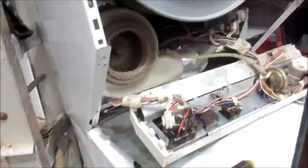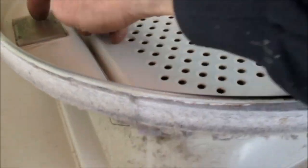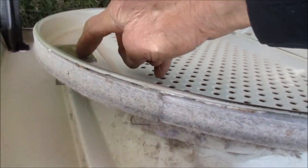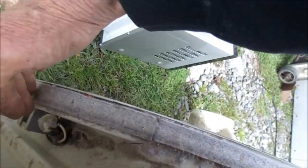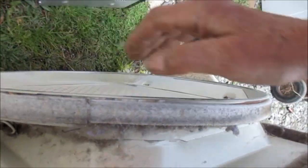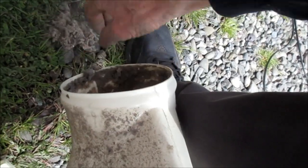Okay, so we got the front panel off. I've seen some of these where they don't actually put a light in there and they leave this part open. If you don't have a light in here and that opening is open, you should take some metal tape, clean that off, and fill that in — it will give you better suction. You always want to check this stuff here and make sure you're all clear.